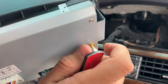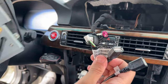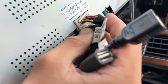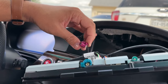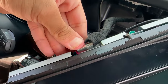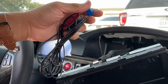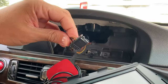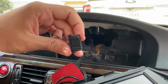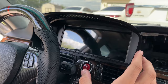Here's the cable that lets you plug your phone directly to the CarPlay unit - grab the USB ports and plug them into the new CarPlay unit. Now grab the purple cable we disconnected from the OEM iDrive and install it at the bottom into the little blue port - it snaps straight into place. There's one last connection point - I believe it's a Bluetooth module - and it plugs into the very last blue port. The stock iDrive harness that's left over does not connect to anything; just leave it off to the back.